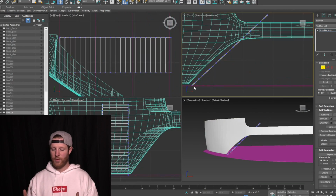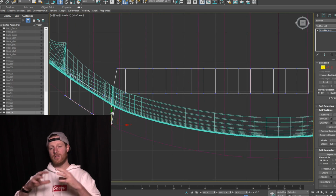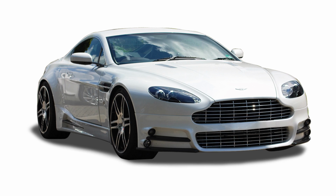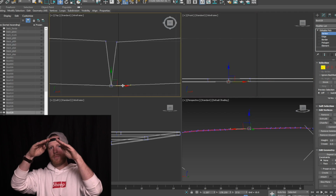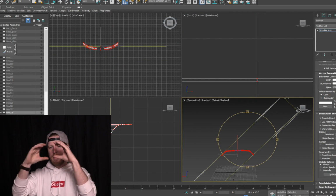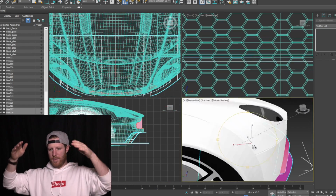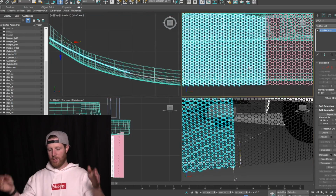Next thing we're looking at is the front lip and the front bumper and how we're going to do that. I wanted a front bumper that looked aggressive and didn't look too stock. Obviously, the aftermarket front bumpers for this car are ghastly. They look like crap and they cost tens of thousands of dollars, which I wasn't about to do. So what we're going to do is take the front bumper and cut into the polyurethane and take the front opening that is in the main front of the car. It's got a little mouthpiece, little opening, and we're going to cut down to the bottom of the bumper, which will bring that down and leave a nice big open hole.